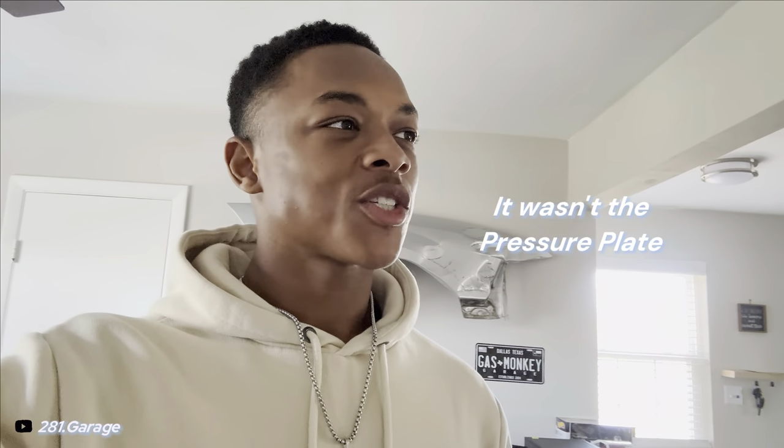I don't know why my pressure plate is so tight. It really confuses me because it's been like that since I bought the car. And my pivot ball is worn out, but it's not really worn out to the point where it would change the geometry of the clutch fork that much to make it that hard to engage. So I'm gonna just do the oil trick and see if that works. And once we get that all buttoned up, then I'll run y'all through the two-step.